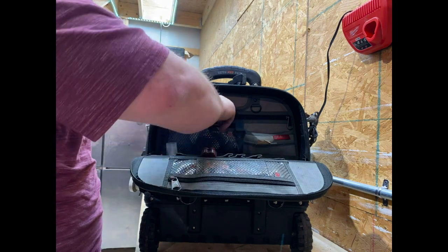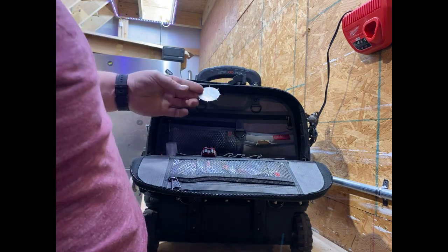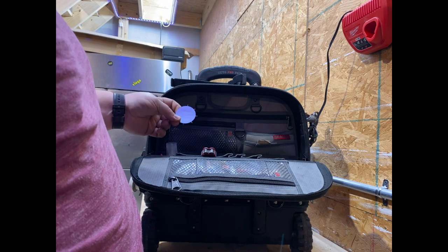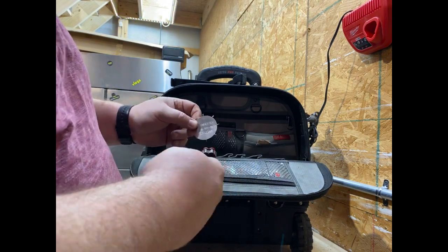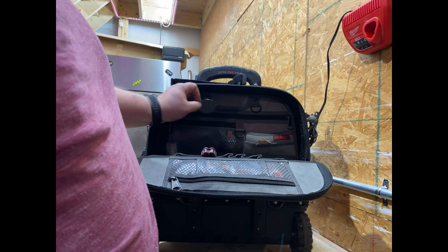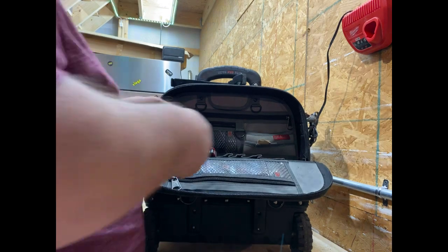This part, keep a couple extra cloth thermocouples. Let me see if I can get this out without killing myself. And then the ever so crazy Frymaster Ninja Star. This is for little black microamp connectors on their boards and stuff. These little pins is how you get the wires out. So you actually push this in there and the wire pops right out. So you keep it in there. Be careful though, because those will go right underneath your fingernail and you will bleed. So I just keep it tucked up out of there. I'm not in that one very much.